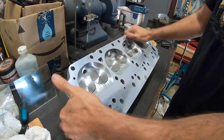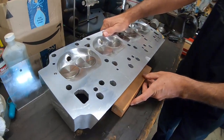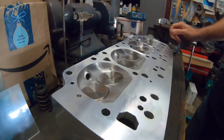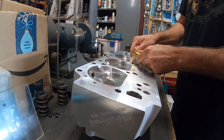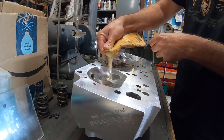And we're going to set the head up with this end being a little bit high, so when we pour the liquid in, it'll go to the top like so. Oh, so it's kind of as straight as you can get it. Horizontal, that's the right word. Well, you don't want it totally flat. You want a high area so the air will come all the way to the top.